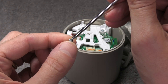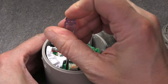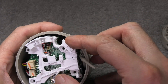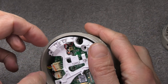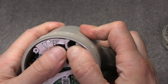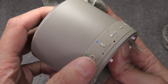I decided to tighten down the four screws at the very bottom of the housing — it's really helpful to have a magnetic screwdriver at this point. This didn't fix the problem, so I removed the three screws from the top again and pulled out the entire PCB, reseating everything. Eventually I got it in right — I'm not really sure what the difference was, but now the buttons function, the USB-C charging port is in the correct location, and we can also hear the clicking sound when pressing the buttons.